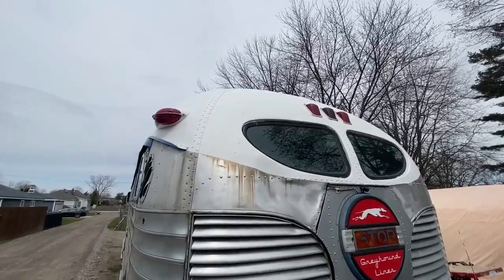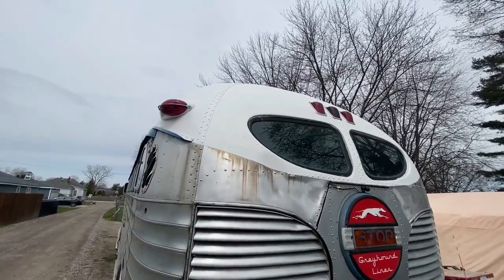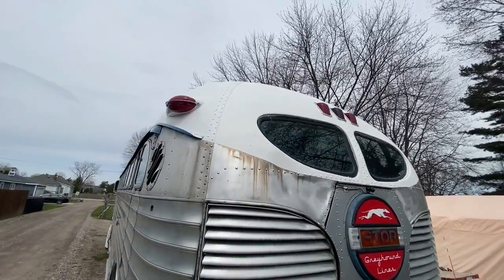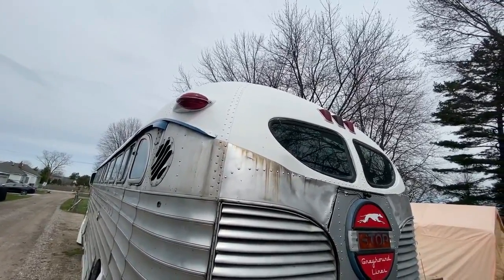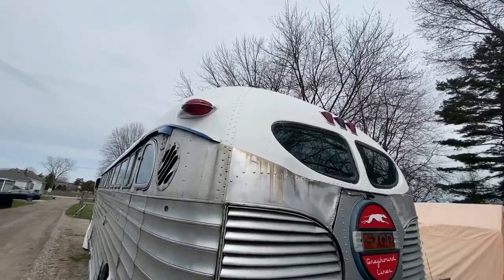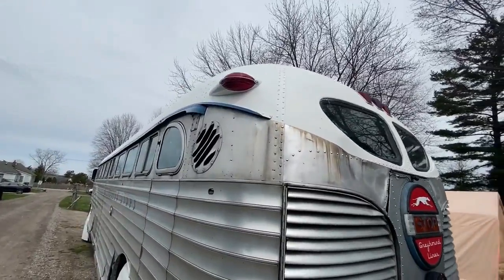For the roof coating, that's Henry's cool white roofing — it's a silicone rubberized roofing that went on really easy. There are three coats on the flat sections and four to five coats on the seams, but at least four coats on everything.